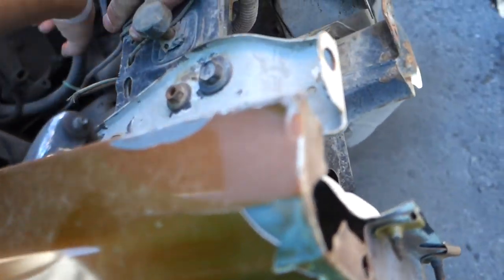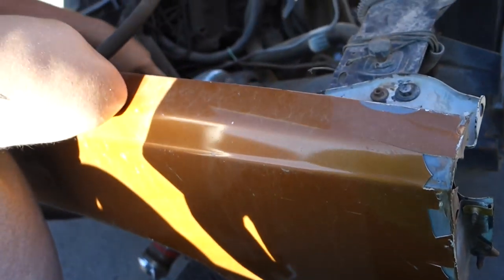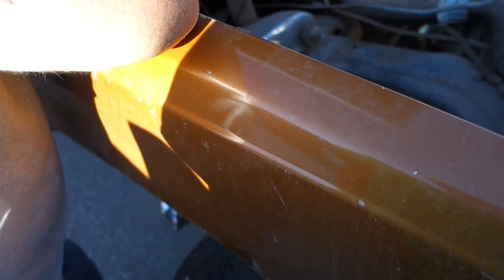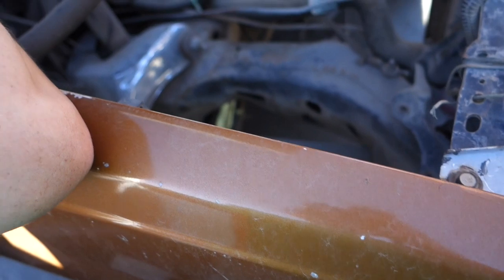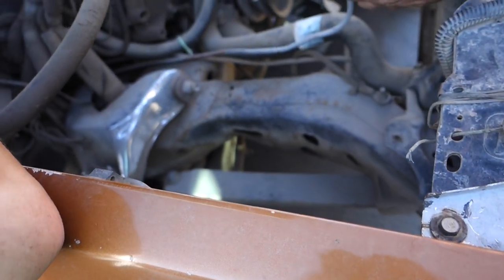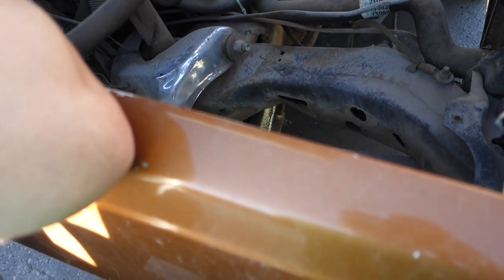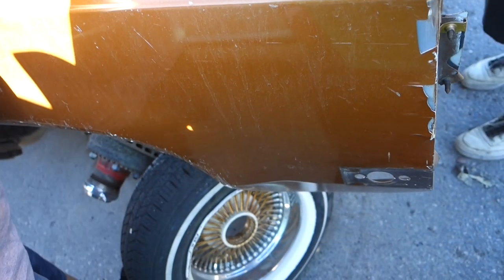Take note of that frame — the way Pinky did his, he put like a tube so that frame area isn't even heavily reinforced around that spring pocket. You don't see a bunch of heavy plates or steel hanging out in front of those. I would weld a pad in there that's threaded and tapped, and maybe have a pad come back further so you can have something that'll catch a pocket, bolt it down, have the leaf spring come up, and even get a turnbuckle to preload it.